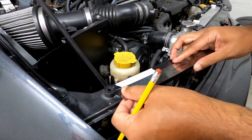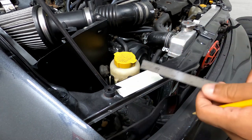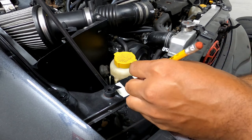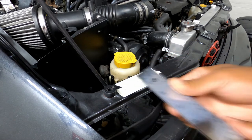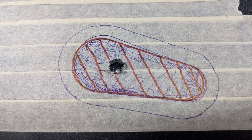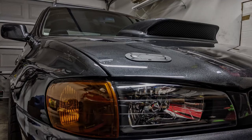For the anchor, I just used the bump stop and the top of the crossbar to measure where my hole should be. Just like the first latch, I installed the anchor first, then I drill and cut the hole for the latch assembly. Because I used a template, I am able to duplicate the angle of the first latch pretty easily. Then I cut out my markings, confirm fitment, and the other side is done.